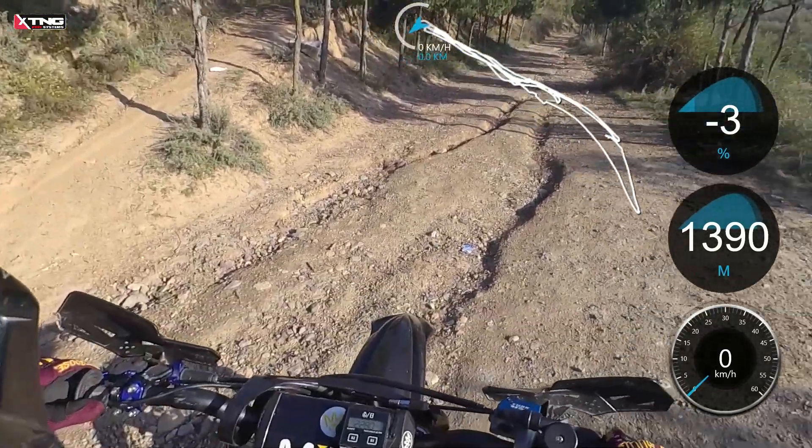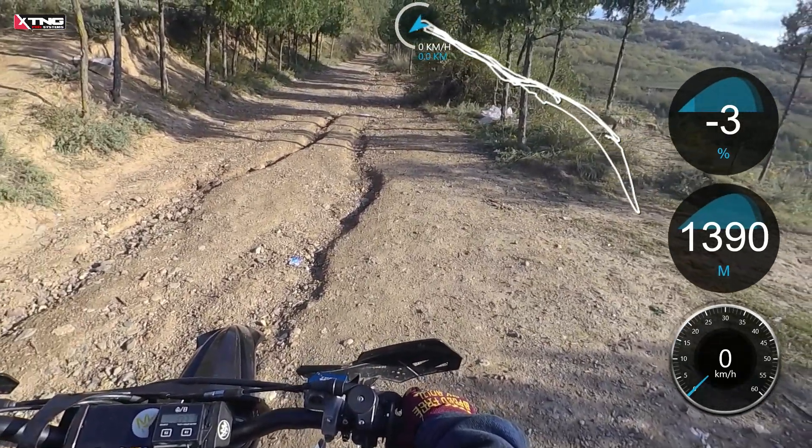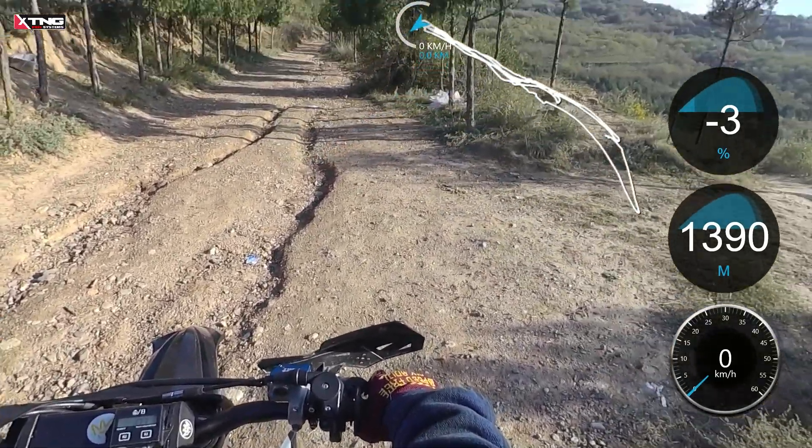For this test, we're using the multi-circuit fuel mode. The metering rod code is SK with 110 clicks. We highly recommend the multi-circuit mode because it allows for precise tuning of both low-end and top-end performance.